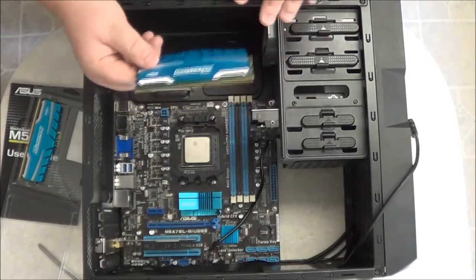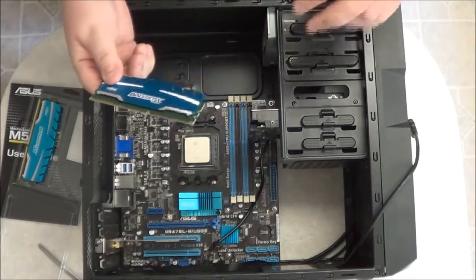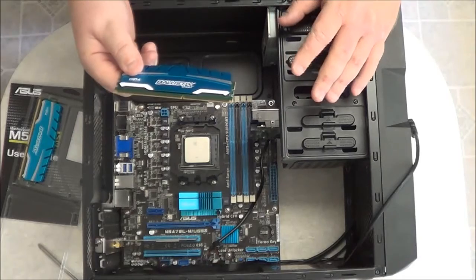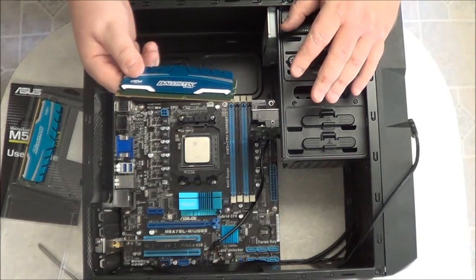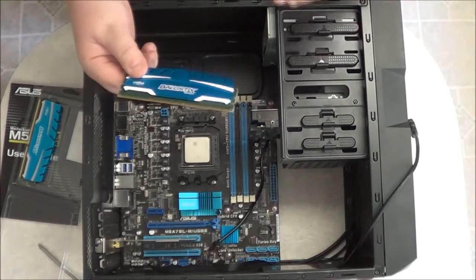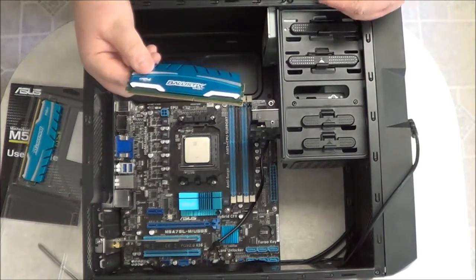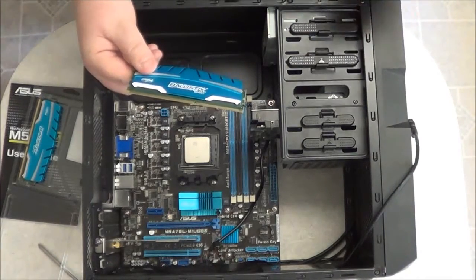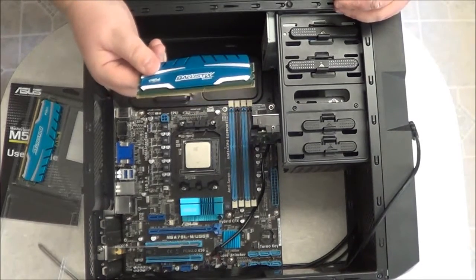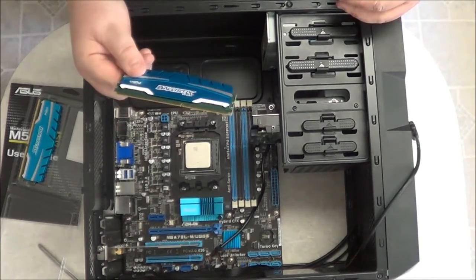Now these are DDR3s. That's most common in today's computers. This is what the computer supports. Keep in mind that these motherboards will not support DDR2s or the DDR1s. These are specifically for the DDR3s. Now I do have a complete listing of the memory modules and the types on my website. Now they do have DDR4s, which are still new, but you will find some computers that can use DDR4s, which are more advanced than the DDR3s.